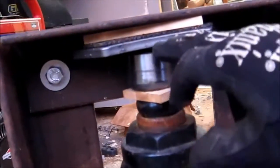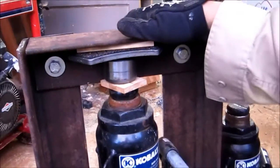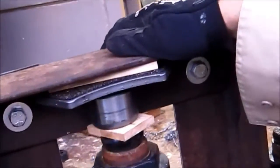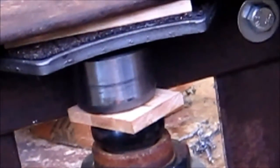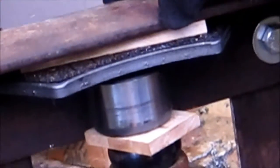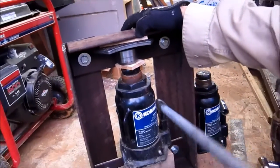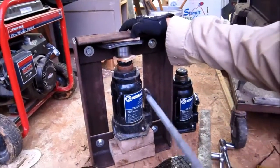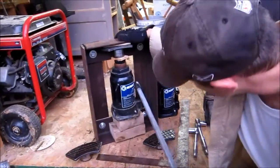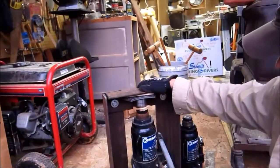What I've got in here — you can kind of see it's a little bit off — but as I start jacking it, you'll actually see it compress in there. You can see some of the oil I've had it soaking in squeeze out, and I'll soak it again after I get this piston attached to that brake shoe. You can see it's starting to close up and straighten up also.